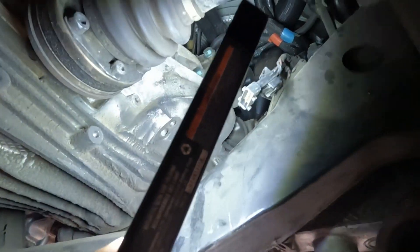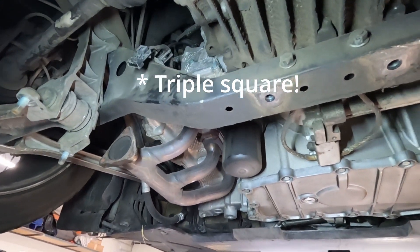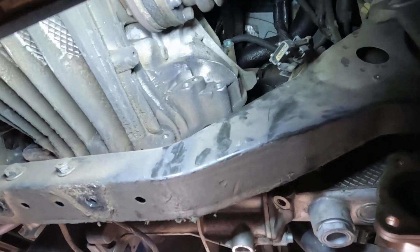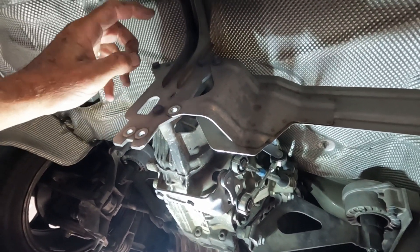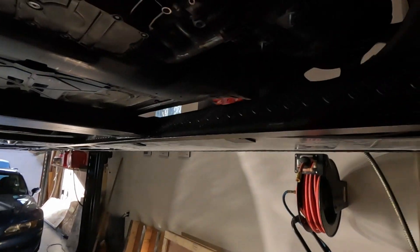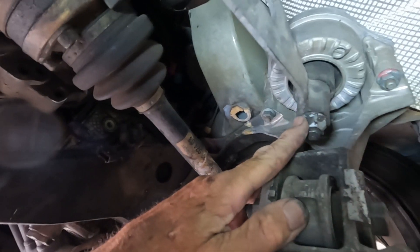What we have to do tomorrow is take all these bolts out, except for one I won't be able to do because I don't have the tool — I have to order that; it's a 'three square' I think it's called. Be very careful when you take these bolts out to identify where they came from because they're all different lengths. We need to disconnect the cables — those look pretty new, much cleaner than everything else under here, so I have a feeling they've been changed. We need to take this bracket and heat shield off because otherwise I don't think you've got enough room at the back to get the gearbox out. The gearbox supports have to come out — undo these two bolts, but do not touch that one because apparently that will damage it.